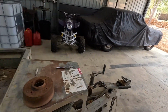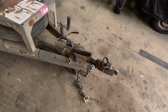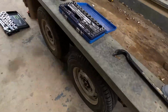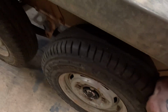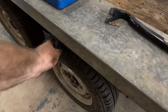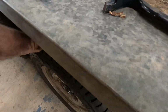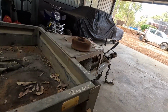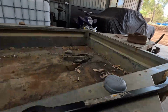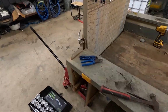And then what you've got to check, once that's all done, I'll show you. So you pull your handbrake up, and then your wheels should obviously be locked. But what you're supposed to do is they're supposed to go backwards. Ooh, and you get this free movement, and then it tightens up and locks in. And watch that handle, I'll do the next one. So that moves backwards and backwards, and then once that's done that kind of locks in like that.